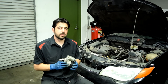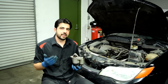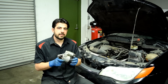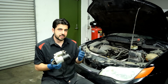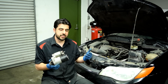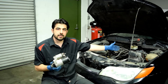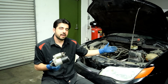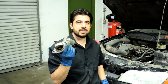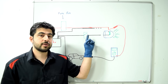By now some of you might have figured out why sometimes, especially if you have a weak battery, your dash lights and headlights go dim whenever you start your car and engage your starter. Your starter has very low resistance to the flow of current, so whenever you start your car the current from your battery finds it much easier to go through your starter rather than through the junction box and through all the different light bulbs and sensors, which have a much higher rate of resistance to the flow of current. It all makes sense now that I've explained it to you.